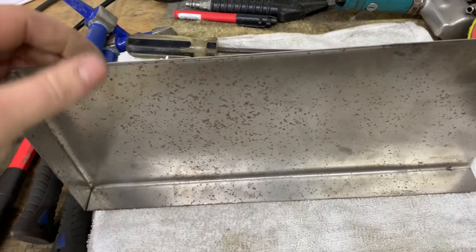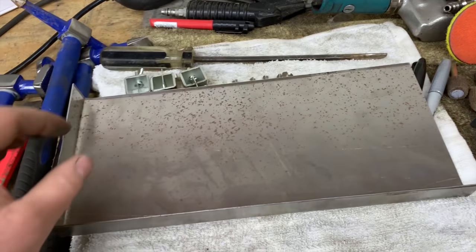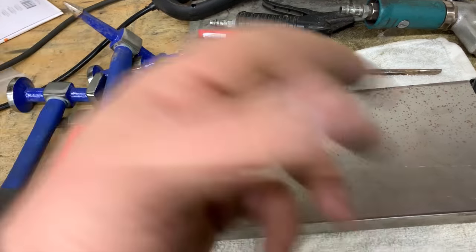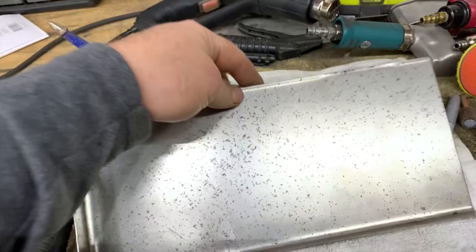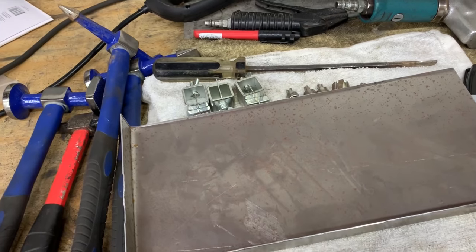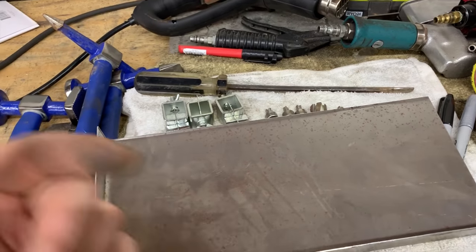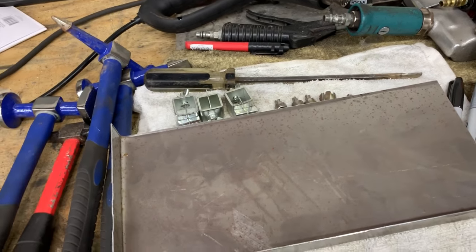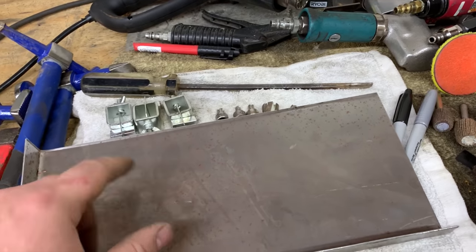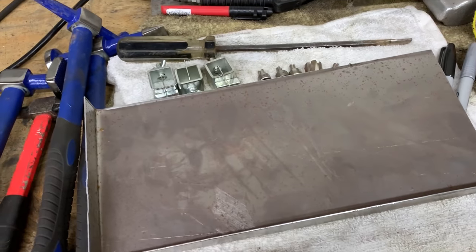and then if you can get to this, I recommend spraying a beeswax. They make all kinds of beeswax applications where you can stick a tube up behind whatever you're welding and spray a beeswax on it to cover the weld joint up so stuff doesn't creep in behind your weld joint. If you have a pinhole or somewhere you didn't weld it good enough, moisture will get in behind it. And if you have a body filler or anything on the front of it, the moisture will push the body filler off and then you'll end up with a bubble. Moisture will actually start transferring down the weld joint and pushing all of the bodywork off the whole weld joint and just generally making a big giant mess and having you start over.